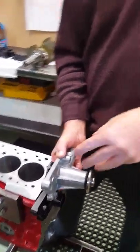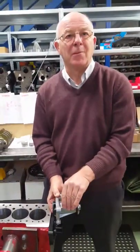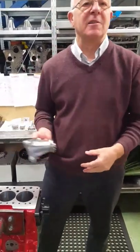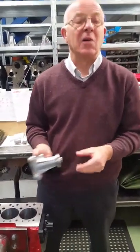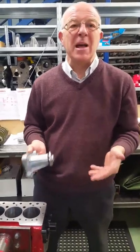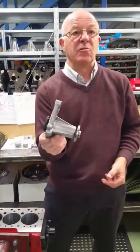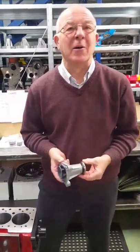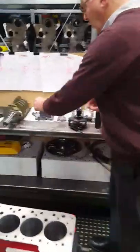You need power to drive the pump, and the power comes from the engine. If you got rid of this you save power — an increase of maybe three bhp to the engine without this running. It doesn't sound that much, but in terms of a limited formula, percentage wise it's pretty massive.